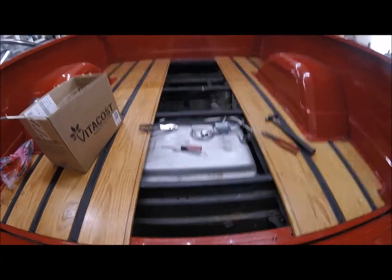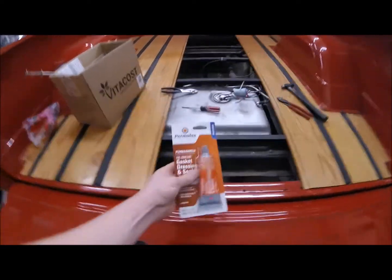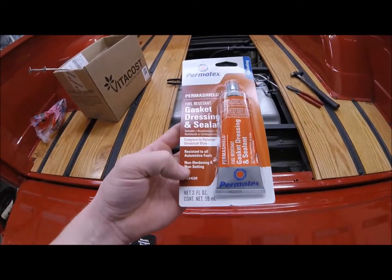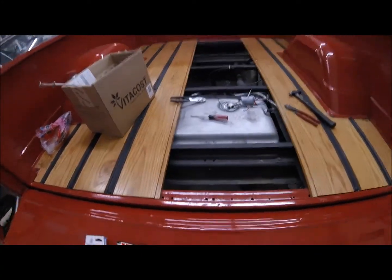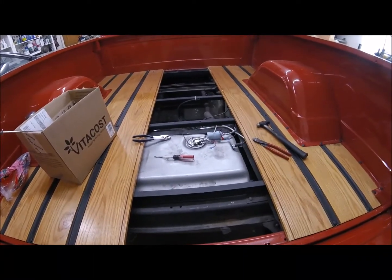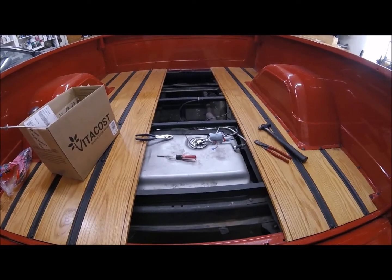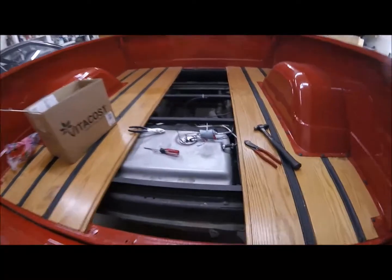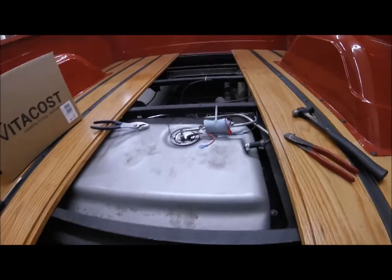And then I think I'm going to crack open the fittings, because I had to get them really tight in order for them to not leak, and I'm going to put some of this in there too. It actually, in the directions somewhere, says that's how it's used, is to put on flare fittings and whatnot to keep them from leaking. So I'm going to put some of that in there, and I guess I will show taking all this apart just for my own future reference.